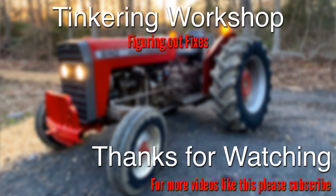Here's definitely where the original problem started. I started to open up this wiring a little bit and I have my purple line coming in, but this here is the line that's supposed to be attached and it is not attached to anything. Also one of my red feed lines looks like it's been cut. I'm going to remove all this loom to see what's actually going on in here. I went ahead and disconnected the battery so I don't have to worry about shorting anything out. Now I'm just going to remove the wire ties holding this loom in place and pull this back to see what's going on.